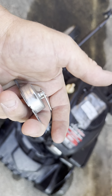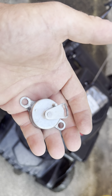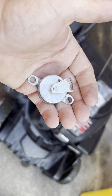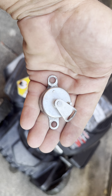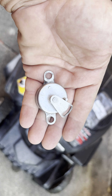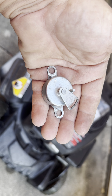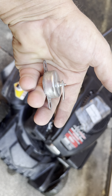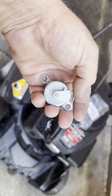A better videography would have taken a chop saw and opened up this canister, but you can see a ring of spring inside with that bimetal characteristic. I'm old enough to remember Solex carburetors on my VW Beetles that used the identical principle — circa 1930 technology — to get the choke to open and thusly lean the mixture.